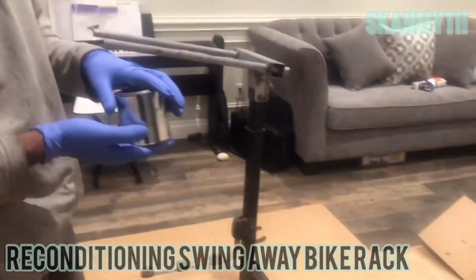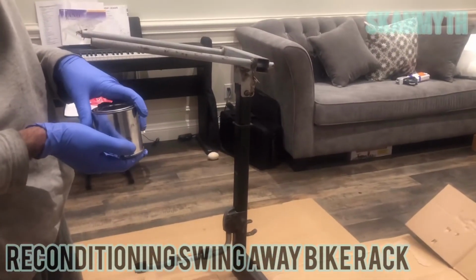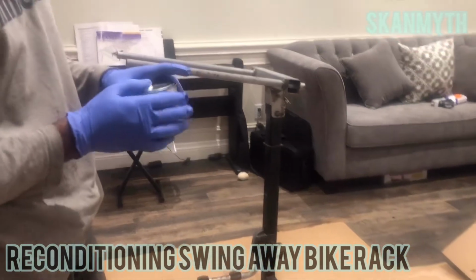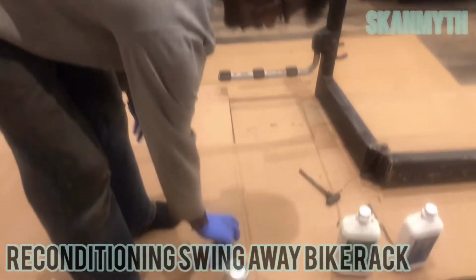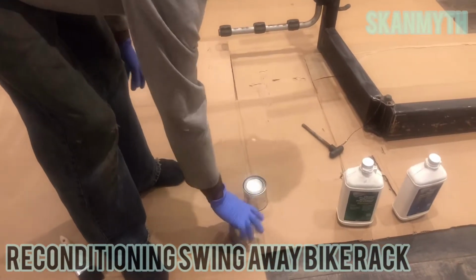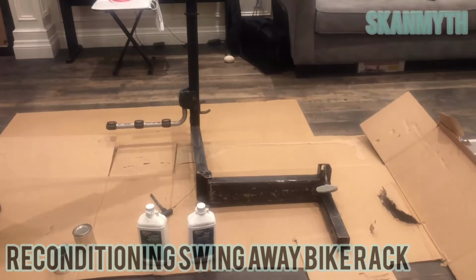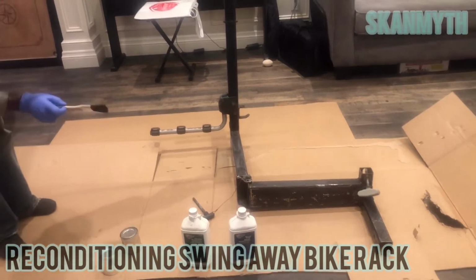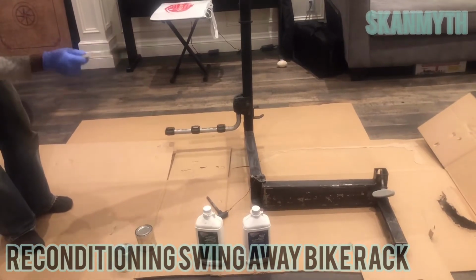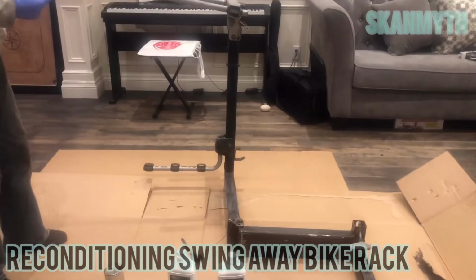I bought it and I used it under one of the cars to give some undercoating, and I have some left over, so I'm going to use this. I have about 1.5 of this. It doesn't take a lot. I had to paint it pretty fast because it gets tacky, and once I use this brush, you won't be able to use the same brush for the second coat because it gets hard like a rock in about an hour or so, and you won't be able to use it again.